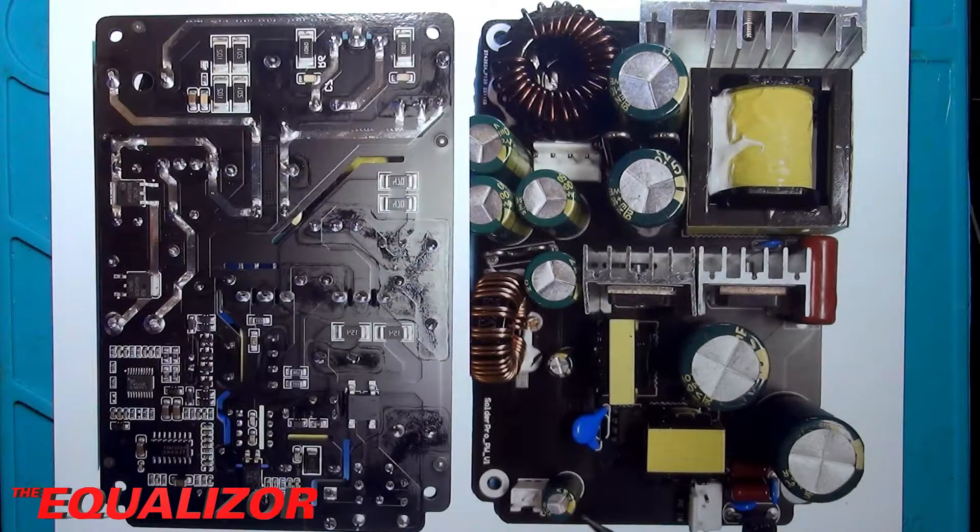All this circuit seems to do is provide an output to this socket here, which is marked 15 volts. The plug that plugs into that socket goes straight onto the control board, which is just behind the screen. And that will be providing power for the ARM microprocessor in it, as well as the cooling fan. The 15 volts doesn't go straight into the ARM processor — there's actually some step-down switching circuitry on that board to convert it to the voltages that the ARM processor needs to run at.